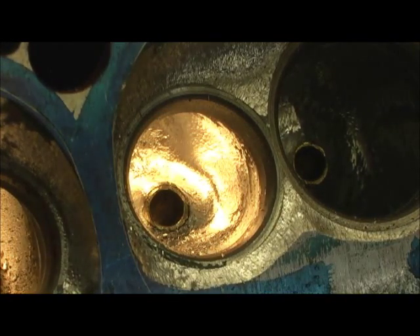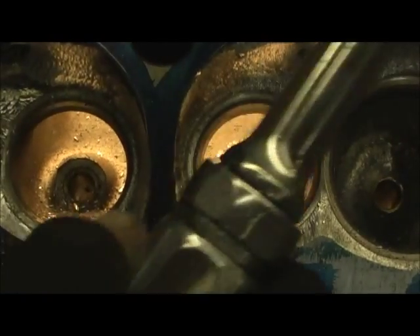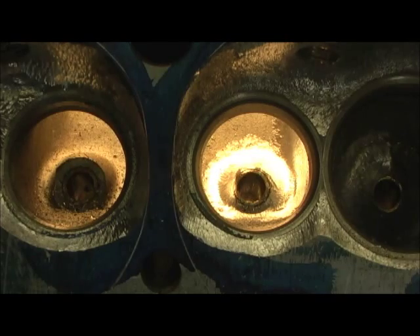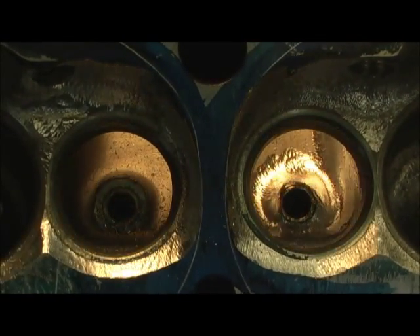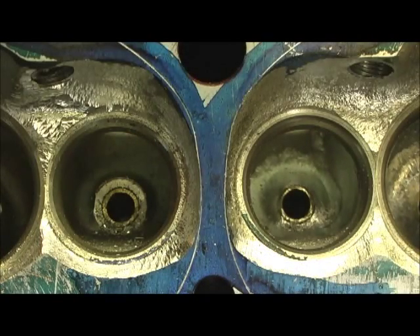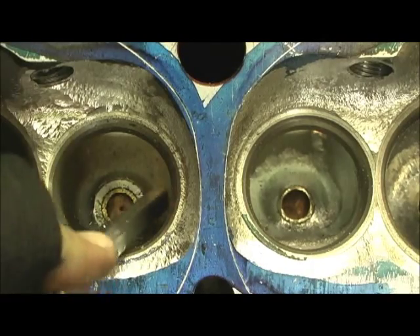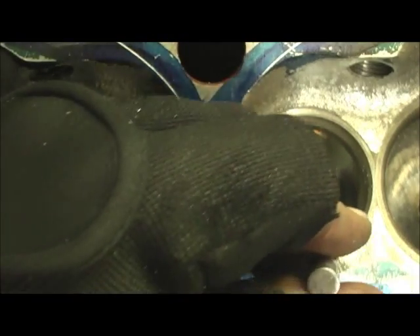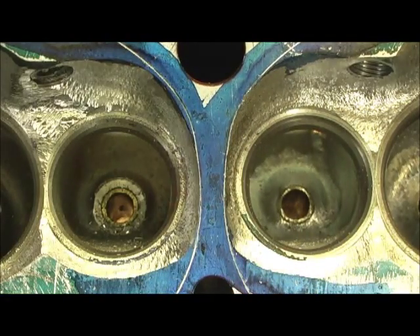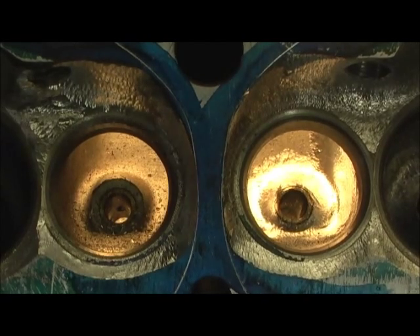All right, now let's try to take a look straight up and see what we got. Now that is much much better. As you can see, we got that big ol' bulge out of the way — just like on the intakes. I'll move the light around so you can see — look at that, ain't that just a whole lot better? We got a lot more area here for air coming out and hugging the roof, versus hitting it solid with this big bulk in the way. You can trim around some on the bottom right here, but as you get to the top you don't want to thin it where you're going to lose material — I still have quite a bit of material holding on to that guide right there.